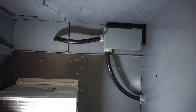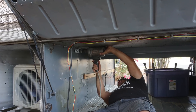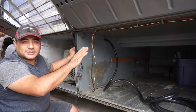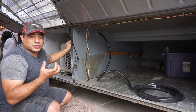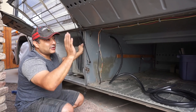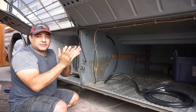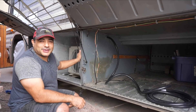The AC travels from our breaker through the AC bay — you can see the wire down there going up through and coming out the other side. We haven't hooked it up yet, but today's project is to install the surge protector in this bay — we'll probably mount it up on the roof so it's out of the way — and then wire in the power inlet. That's going to involve cutting into this door, which we're a little nervous about. We'll need some mechanism so that when the door folds down the wire has enough slack to flex without getting kinked.